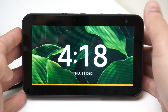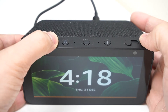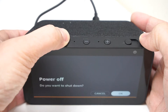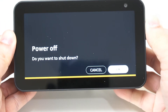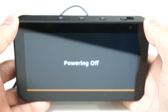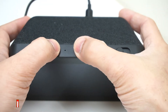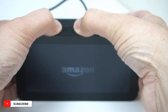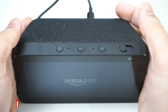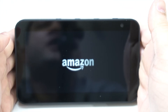It's kind of very easy and straightforward. Press and hold the mute button for three seconds and you're going to see the power off option — press and hold on it. Then press and hold the mute button and volume down button together. You're going to notice that your Echo will be going into the hard reset. Now you can release your fingers from the mute and volume down buttons and wait for your Echo to reset.